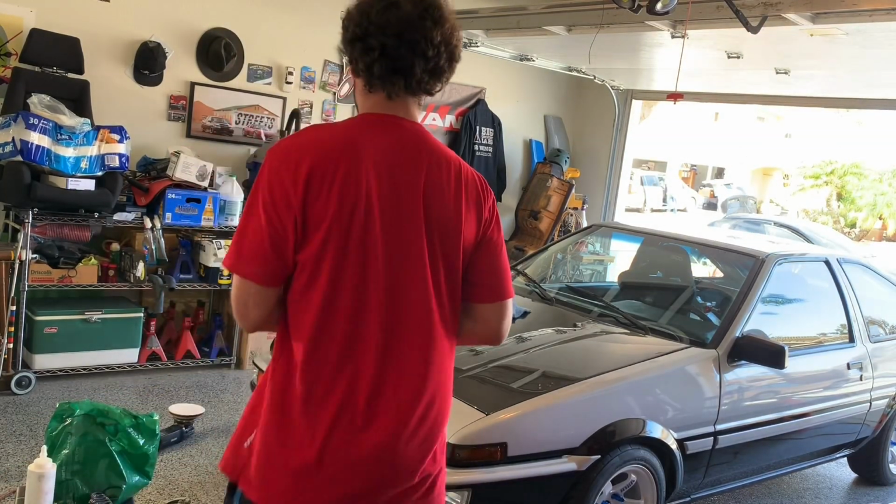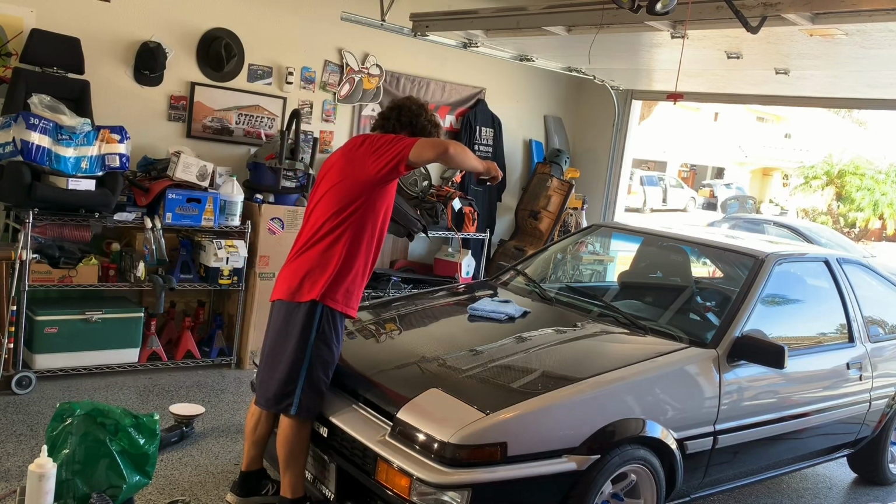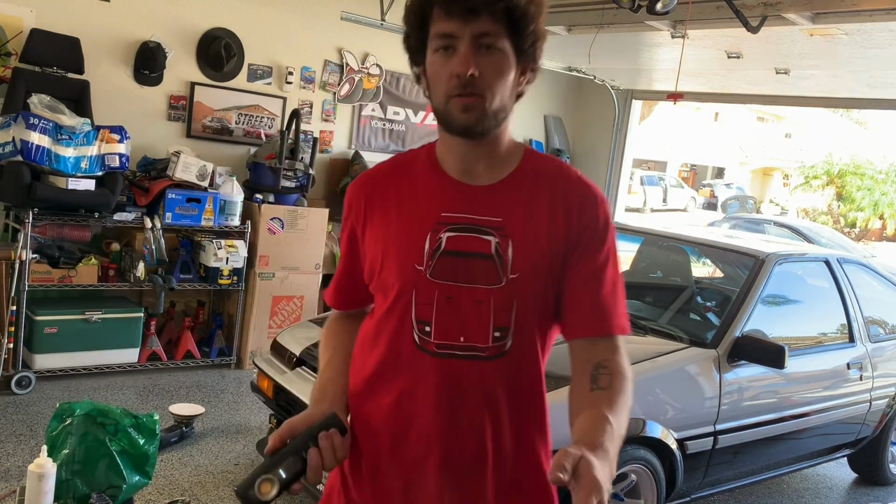So I'm going to check my work really quick. This is looking phenomenal. So let me give you guys another little look here. Super clean. There's still some RIDs. I can see them. You probably can't. And as I said, it's not good to chase those. Because even though it might drive you crazy, chances are your customer's not going to see it. And you're also just taking off so much clear coat. Or they might be below the surface in the paint, depending on who painted the car.